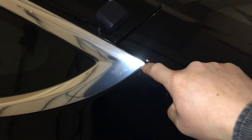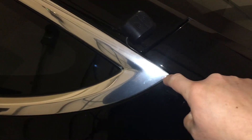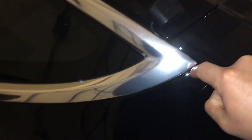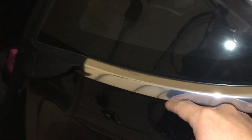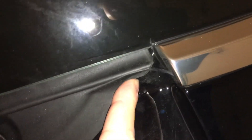Once you put the antenna here, use a credit card to push the little thin cable behind this chrome delete, and follow my finger — this is how I fish the cable. It goes down all over here, and that's where you bury the cable behind this weather stripping. Pull it across and fish it all the way down here.